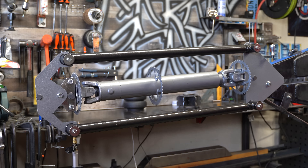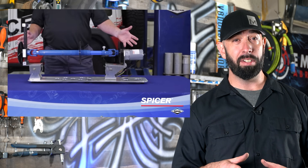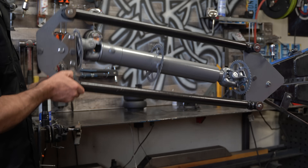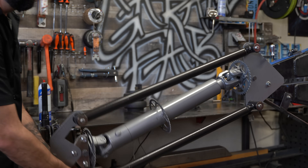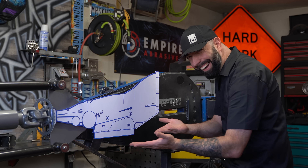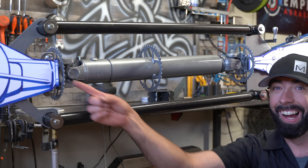And it's happening really fast. If your suspension isn't set up properly, this will shake you to death and destroy your drivetrain. I built a machine to help me demonstrate the sorcery. I borrowed the idea from some other videos I've seen, but mine has a parallel link setup to show real-time changes in a drive shaft as a modern suspension moves up and down. I've attached this to my motorized bead roller, which will resemble your vehicle's transmission, making the other end the differential.